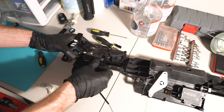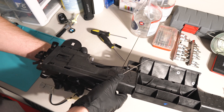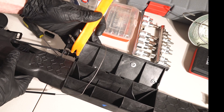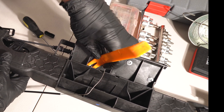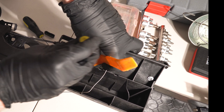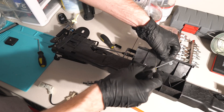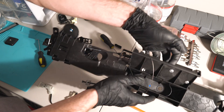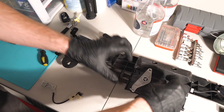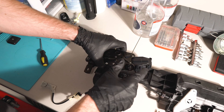In our case, something was stuck between the micro switch and that lever. If you remove the wire, it's that white tube - you have to press three points. Press two tabs with a plastic tool, then use a screwdriver to press the third tab, and it pops out. You'll also need to undo two T20s holding the servo or actuator motor, and basically the job is done - pull the wire through the opening.